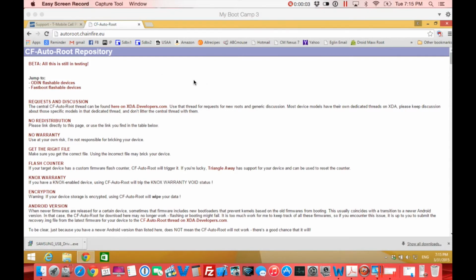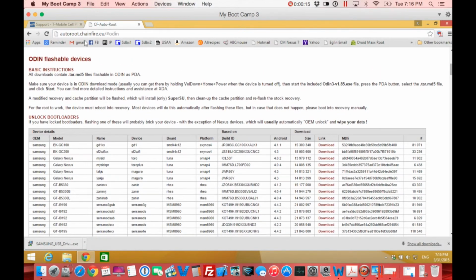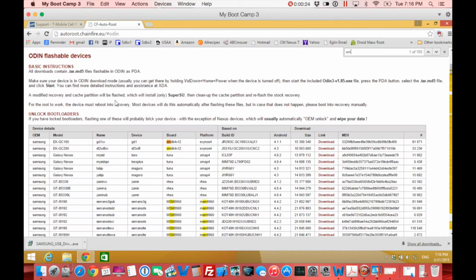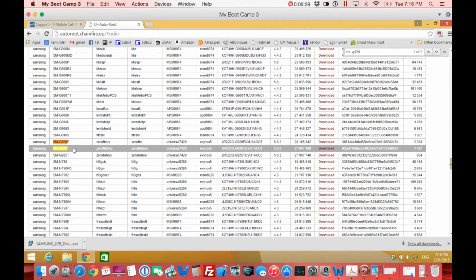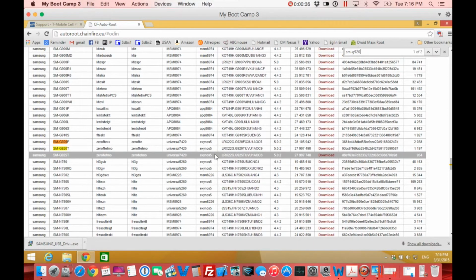Alright, second thing you're going to do, and again this link will be in the description. You won't have to do all this clicking, but you're going to go to the Chainfire website and then Odin flashable devices, which is your Samsung, and this link right here will actually be in the description. And so I'm gonna hit Control F and then SM-G920, and right there, that's the one I want. And so I believe the F is the Edge and the T is the regular Galaxy S6.